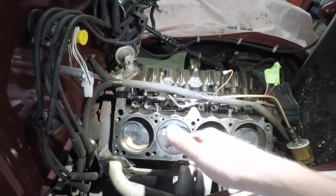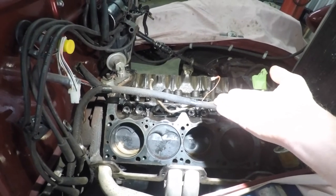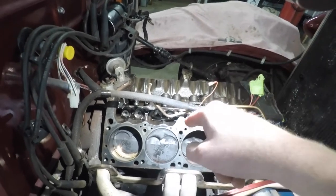What we eventually found out was that the valves were coming down and they were hitting the top of the pistons. In some cases that might mean you've got too big of a cam in your engine, but if the person who built this motor had done it right, we likely never would have had an issue. Because of that noise and those valves just barely hitting the pistons, we felt like we were getting a vibration. We tried the TCI Rattler harmonic balancer, which basically has little shot in it — if you shake it you'd hear it rattling around — and that helps distribute any irregularities or unbalanced crank/driveline issues, but the vibrations were still there.